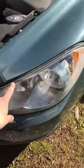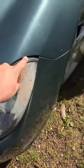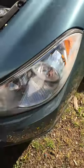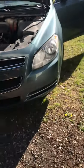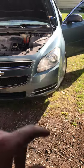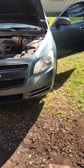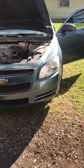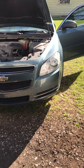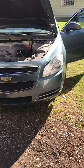The seal right here is showing a little bit — it's just a little bit out there — but the headlight is still secure. It just sat in there differently. Those two bolts — the one right there and the one on this side — are 10 millimeter, but they do have a grommet on them. Make sure you put those grommets in there, because that's where the extra time came from: having to take those back out and put the right ones in.